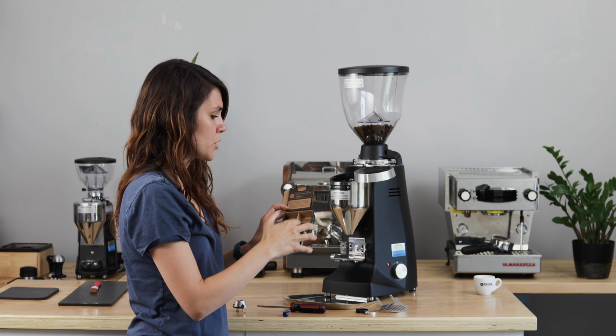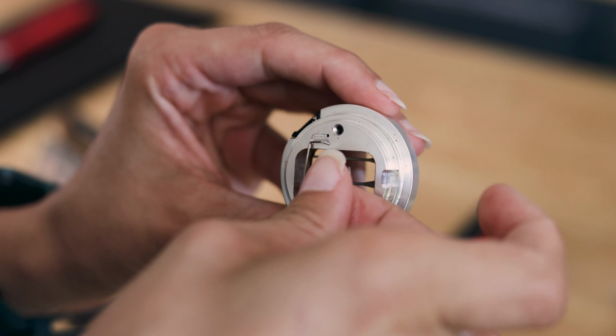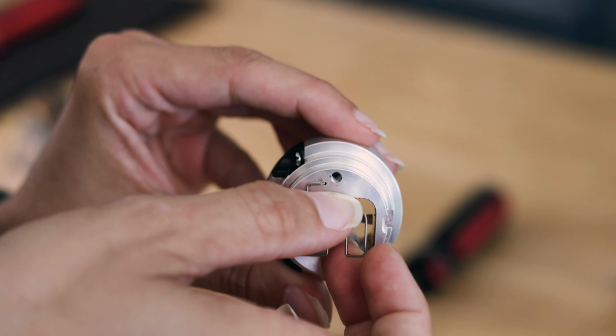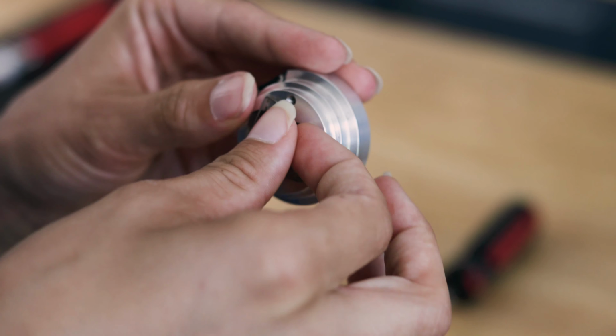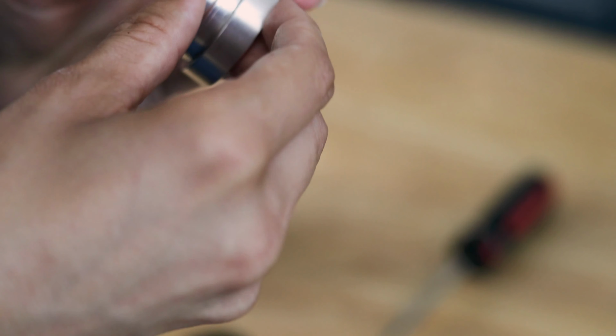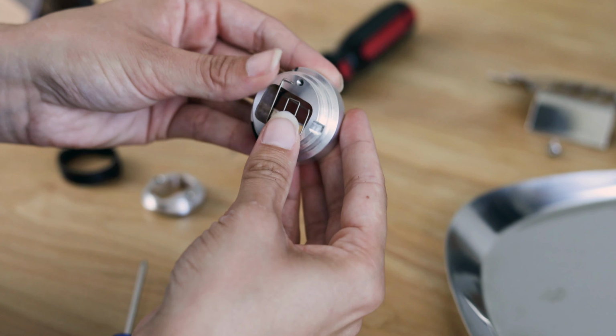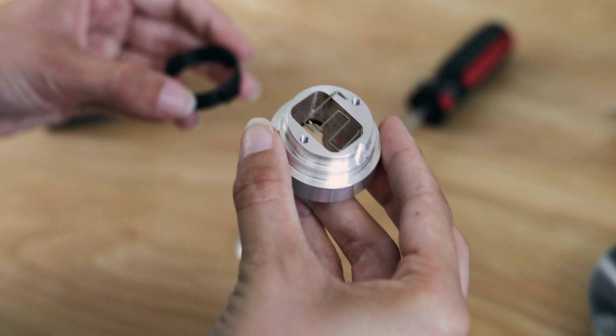And in box 2 is the anti-dust damper. It is shaped slightly different, but it does have the bent edge. This will slide into the hole, and there's also a groove that aligns with the shape of the damper, and you want to make sure all of it is aligned perfectly. Just slides right in, and it should lay flat against the metal.